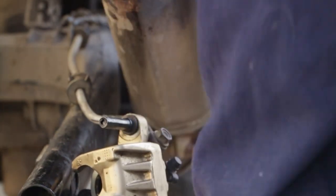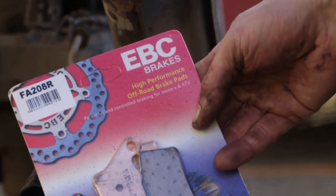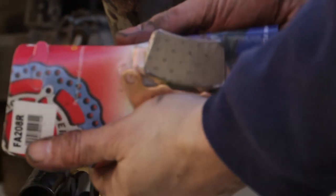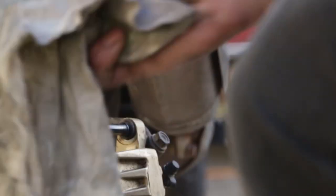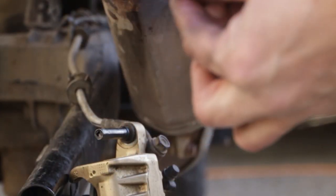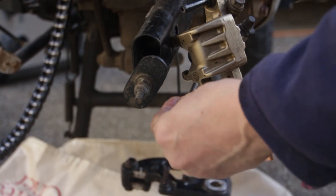The pads I'm going to use are the FA20AR. I've gone for these on the back because, although they're not as sharp braking as the front ones, I figured I don't need that — and these are longer lasting. The back brake seems fine and doesn't need the upgrade the front brake needs. Make sure my hands are clear of grease before handling the pads. Just a tiny amount of grease on the back edges to make everything work well.